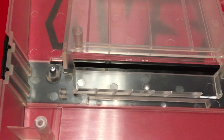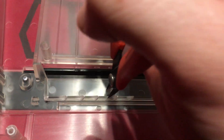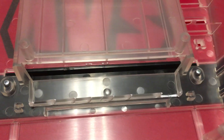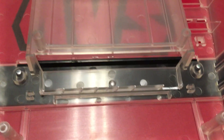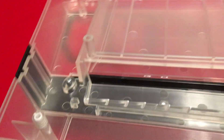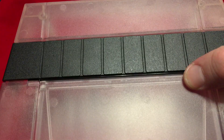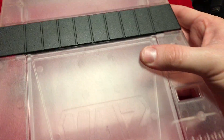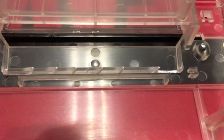The way I found to do this was to take a wire cutter that I typically use for soldering projects and go down the line, just making these cuts. Then I snap out pieces. I was a little nervous about this because I've seen modifications to joints like this, especially on clear consoles, cause imperfections on the outside of the shell. Fortunately, where you do this is underneath the black part, so I don't have to worry about anything showing through. A Dremel would probably be a good way to do this, but using wire cutters is free with what I have.